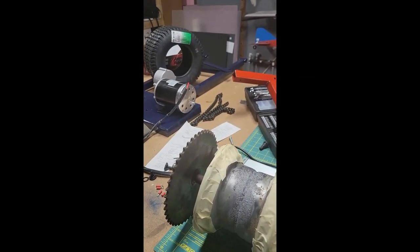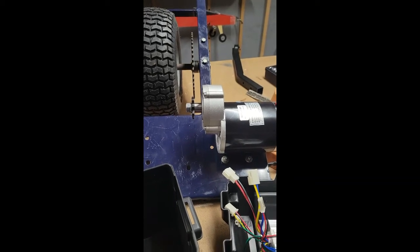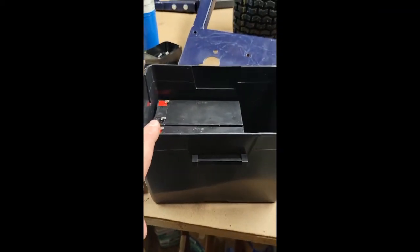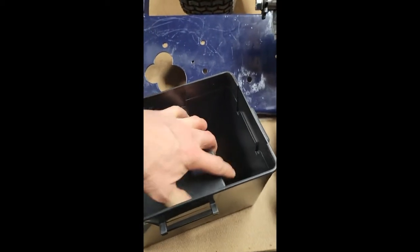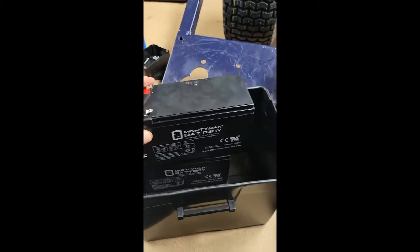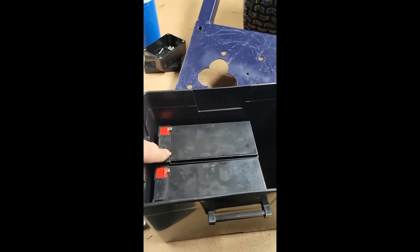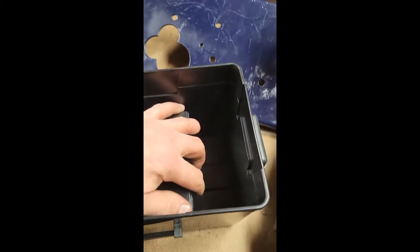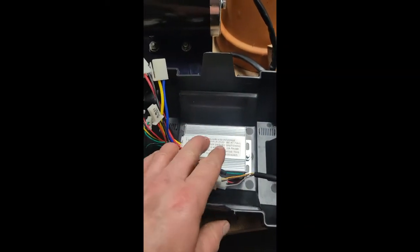Got the motor mounted and the chain cut to length, but I'm leaving the chain off so I can easily move the unit back and forth. I picked up a U10-size plastic battery box from Amazon, and two Mighty Max batteries — 7.2 amp-hour, 12-volt. I would have liked an F2 connector but the F1 connector is okay; it's just a little narrower. These two batteries fit nicely in the box and there's plenty of headroom above, so I can mount the controller in the top of the battery box.